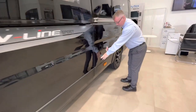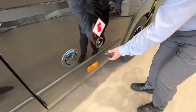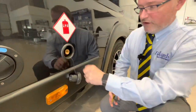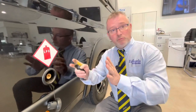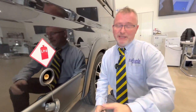Fresh water filler just there, and you fill up the LPG tank just here. Your LPG tank is situated underneath the vehicle. If you've never filled one of these before, you'll notice you've got two prongs just there. You fit it on, lock it into place, and fill it up like you're filling up with normal diesel. When you release the pressure there will be a small amount of gas and it will boom straight up — it will frighten the life out of you the first time but that is par for the course.